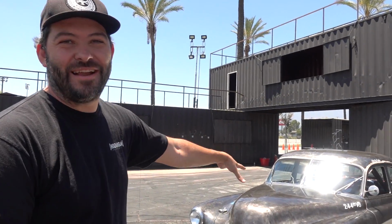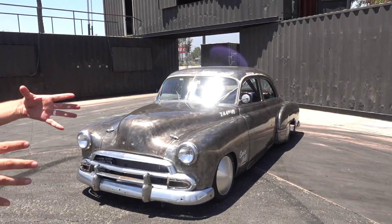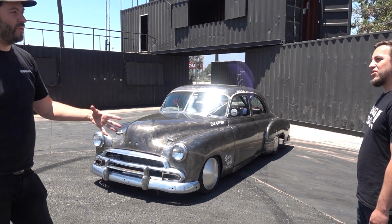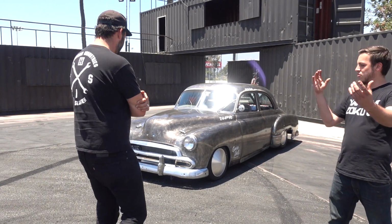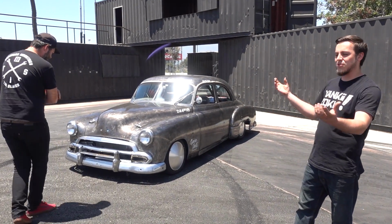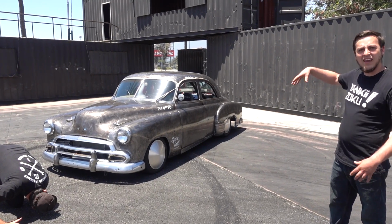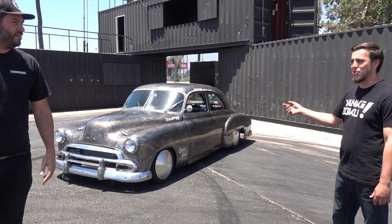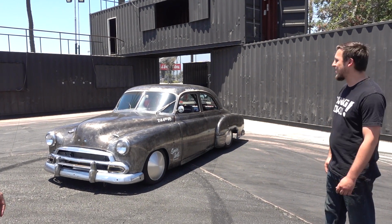I built mine in 65 days, but this still runs, and it looks like it might actually have been way more work. I'm guessing grafting all that to this is a lot more work. How do you, I mean, obviously the LS is a unibody car. How'd you make that all work? So what I did first is, on the Lexus, there is a front subframe and a sort of rear connector. I braced those two together with 1x2 pieces of steel. I also made the cage prior to taking everything off and cutting the body off, and made sure everything was still tight. I actually drove it around the block without the body. Didn't have any issues. The thing ripped without a body, and I was like, this is gonna be fun.